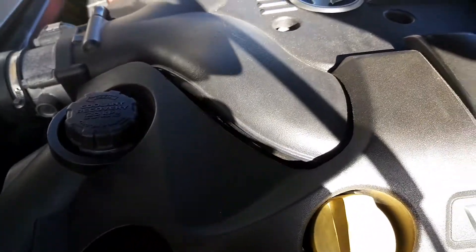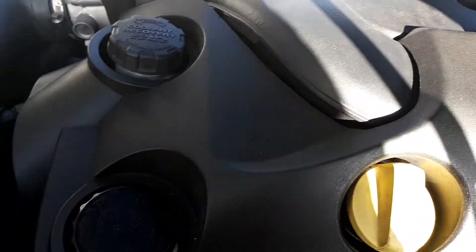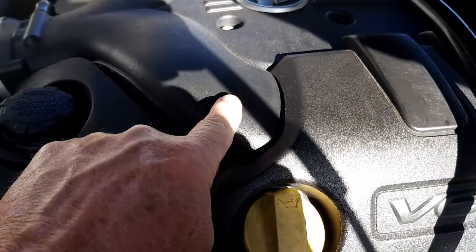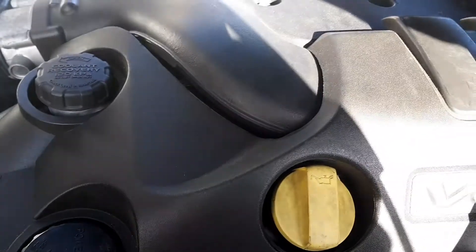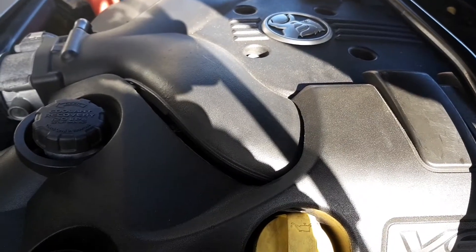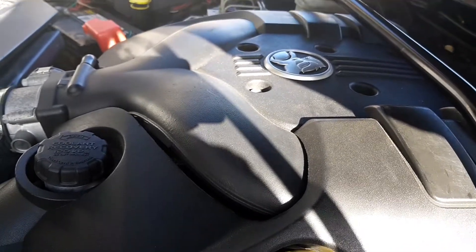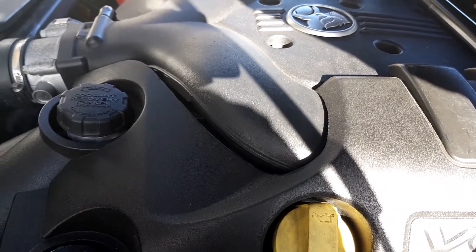You're not going to see much because I've got the engine cover on, but what happened is I always suspected a bad coil. It always had a miss in it when it was cold, and it was this coil here underneath — that was the cylinder that wasn't firing. If it ever happens to you, just pull each wire out one at a time while the engine's running, or turn your engine off, pull the wiring out, and then fire it up again — you'll figure out which one's not firing.